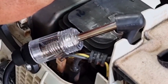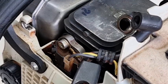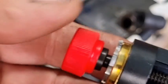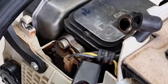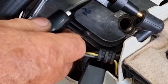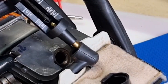Look at that - it illuminates! This tells you that you've got spark. What it doesn't tell you is the strength - even a little bit of a weak spark will light that up. This other one looks like a spark plug gap tester. It's got a little knob - I put a feeler gauge in there the same as a spark plug - so you can vary the gap. By making the gap bigger you can see when your spark refuses to fire.